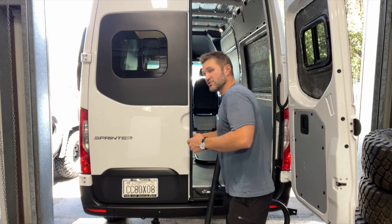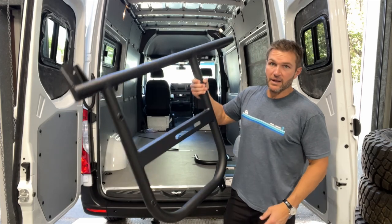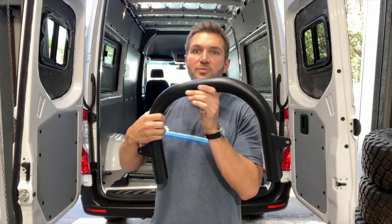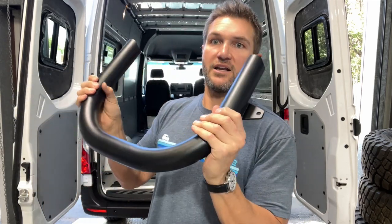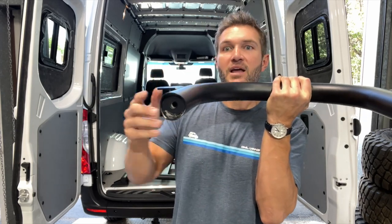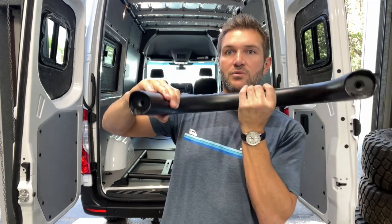To get started, make sure you have all the right parts. Your main carrier — fairly obvious; if you're missing that, it's hard to do the rest. This is what we call a bottom hoop or tire hoop. You'll notice it has a tab on one side, none on the other, because some people like to mount boxes to their tire carriers and some people just want to mount tires. We usually install this with the tabs facing up so they don't get in the way of the tire, and should you ever want to put a box on it, you can.